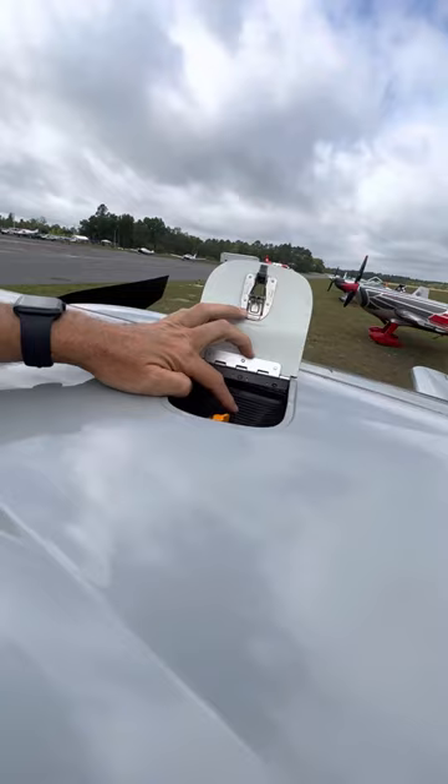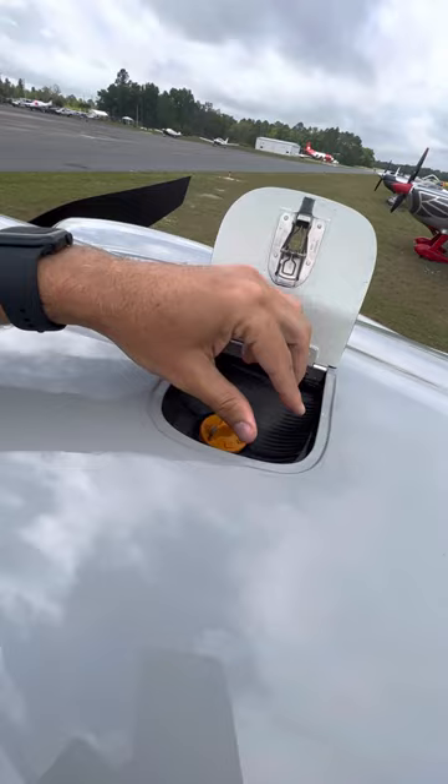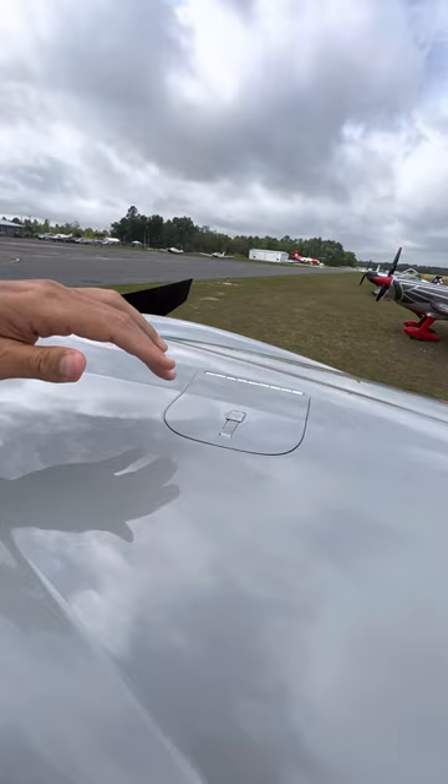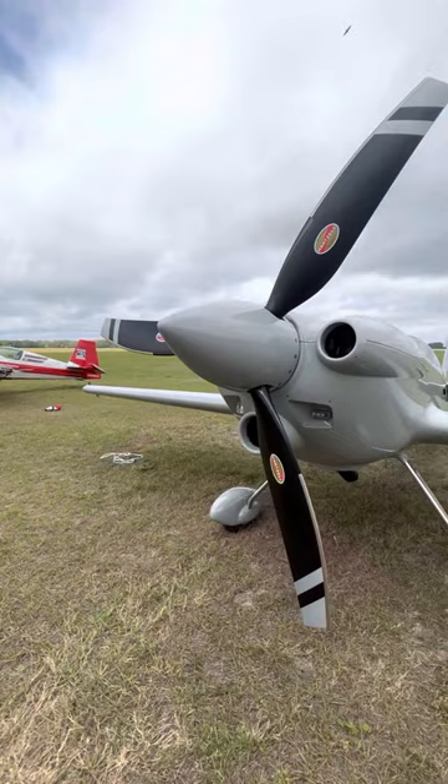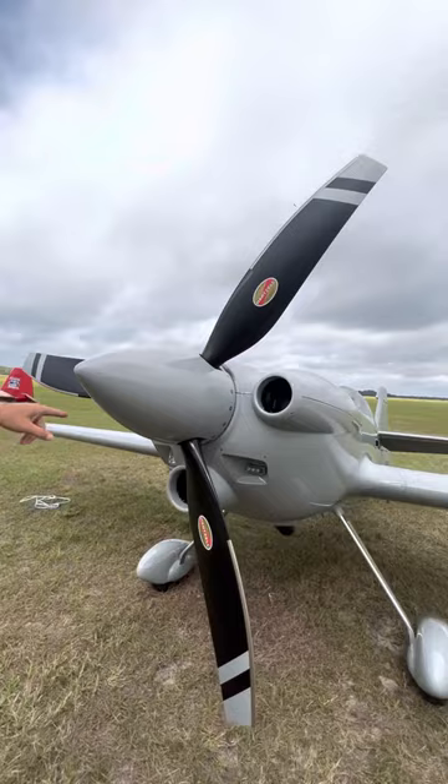You can see there's a carbon fiber plenum sitting there. I can access the oil here, but the aircraft engine is shrouded by that plenum so the cooling air gets in there — it keeps the cylinders nice and cool, and they stay very even. Up front I have a Hartzell Talon, which is a nice propeller. I also like the MT propellers, and I'm going to try a Whirlwind — I'll do some back-to-back testing. But this is a great propeller and one of the options you have.